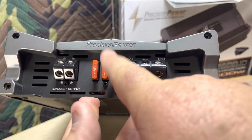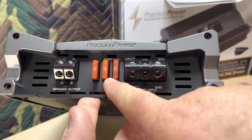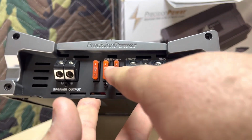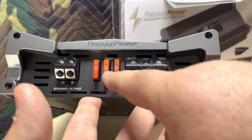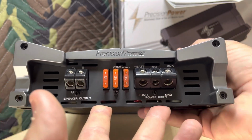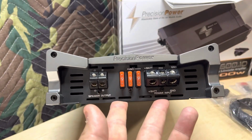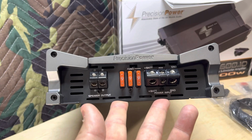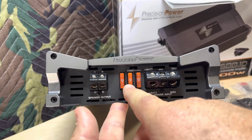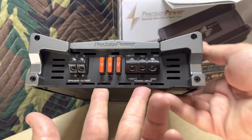That's nice. That should tell us a little bit of something about what we might see out of this amp. Will we see times 10? 120 amps of fusing. Will we see 1200 watts? You guys know that most of the time we do not see times 10, I hope this isn't too blurry, but occasionally an amp will do times 10 or more.